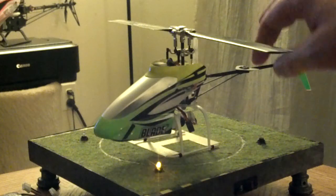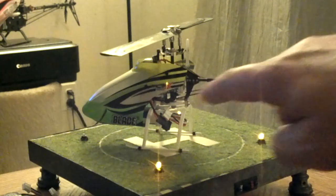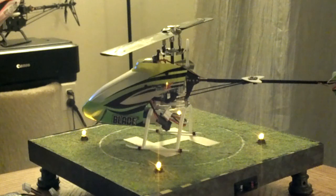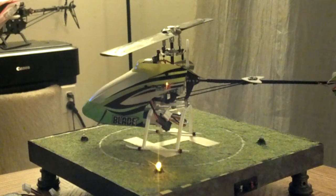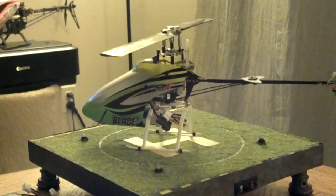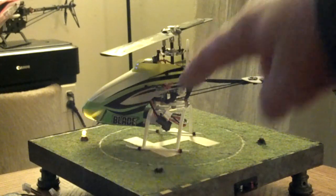If you do want to use the Asteroid Designs boom support kit, you're going to have to buy two separate parts. Number one is going to be the motor adapter plate. It's the same piece that's listed in the instructions on the Advanced X frame, and you'll need to swap it out and use the mounting holes. I'm using the stock main motor on the mCP X brushless. The motor mount screws will run left and right, not forward and back. Dylan shows a picture of it mounted, and I believe that is the first generation or version 2 mCPX, not the brushless one. The mesh is perfect on the motor mounting adapter plate.